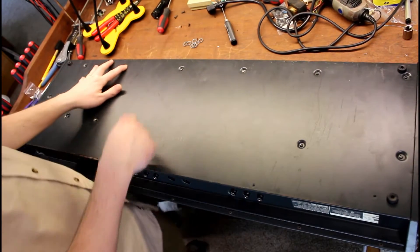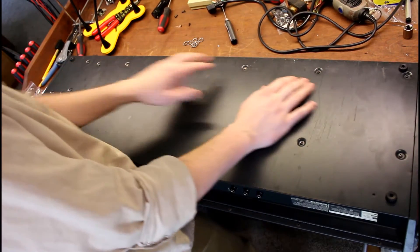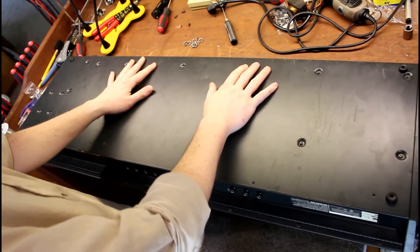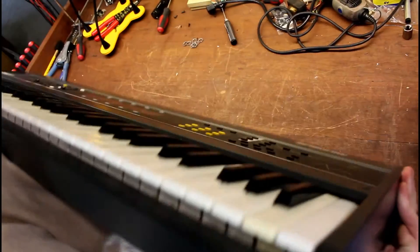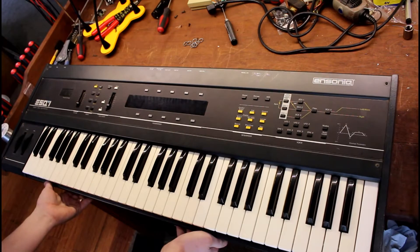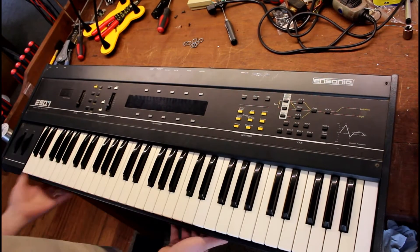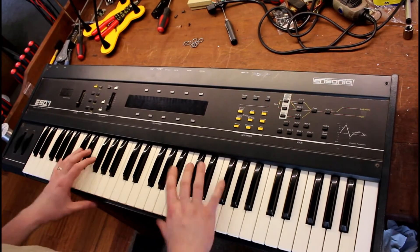You'll be removing these six screws here. But before you remove these screws, I recommend you flip the keyboard over, at least for the last few of them. Hang it off the edge of your workbench and then go from underneath — that's just so that you're not burying the entire weight of the keyboard on just one or two screws and on the plastic post that the keyboard's mounted with.